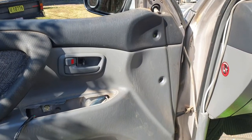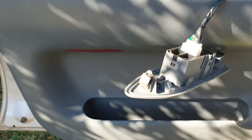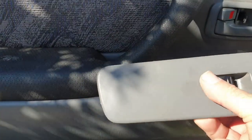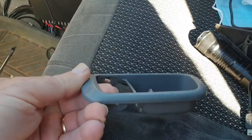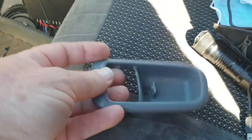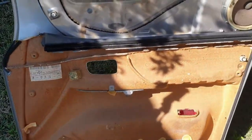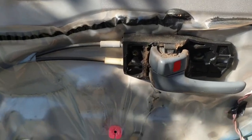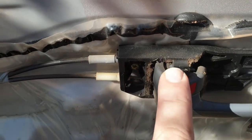Just so you don't get caught like I did — be aware there's one hiding under there, which is where your up and down control for the window is. Just a little tip to get the little cover off from behind here: it's got a hole up there, a hole up there. You just have to get a screwdriver in and pop them out like that, and then it comes out over the top of the handle. So the door trim's off — it didn't destroy anything, which is amazing for me. You can see how it slips off over the top of these handles.